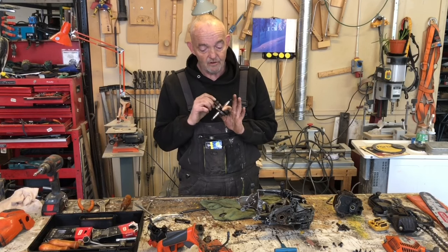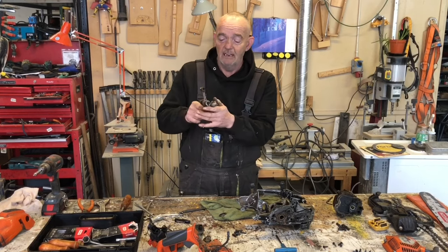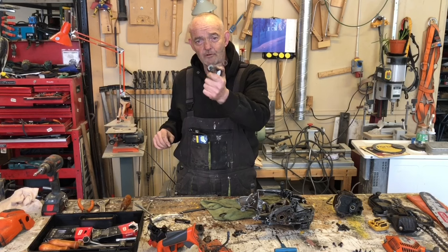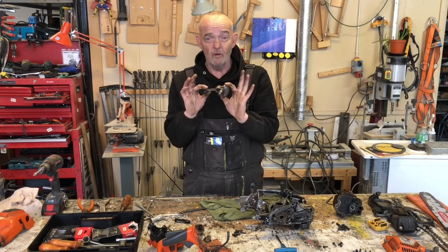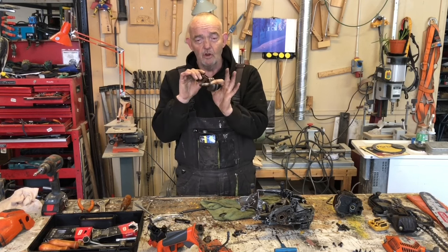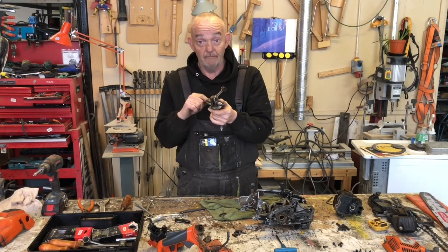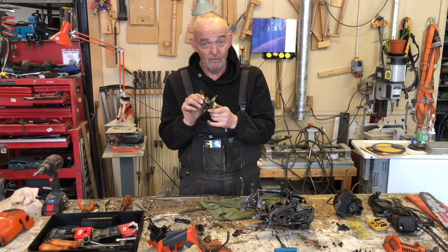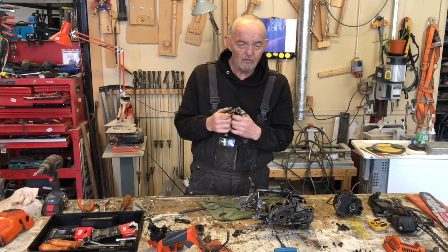Do I need to explain two strokes? Yeah. There's a four stroke. In a four stroke engine, this would be an oil, whether it be a wet sump or a dry sump. In two stroke engines, it's not an oil. It relies on the oil in the petrol to lubricate this. Does that mean that there is petrol and oil in? Yeah. That's how two stroke works. Two stroke doesn't have any oil in it other than what's in the fuel, which means all working parts.